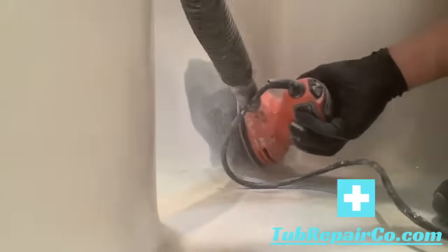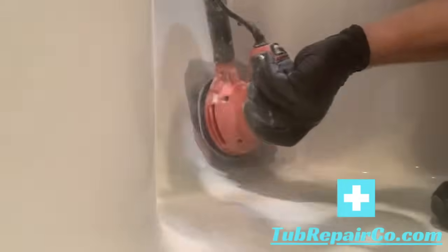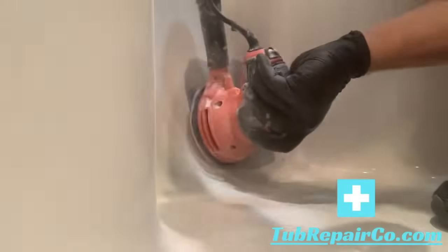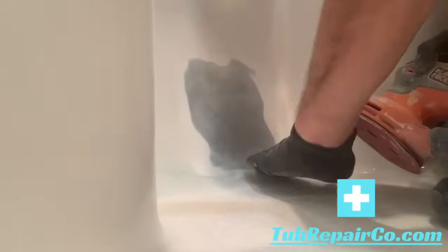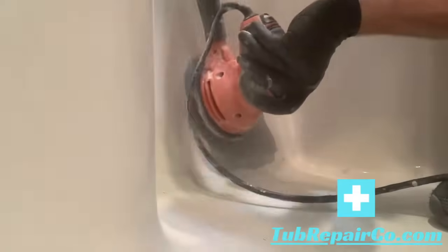As you feather this out, you're going to want to feel if it doesn't feel real firm. If it's got too much give in the middle, you may have to apply a second coat and make that patch a little bit thicker. So be aware of that, and always let it set up and cool down before you sand it. Otherwise it'll just gunk up your sandpaper and it won't stick to the surface. You've got to really let it do that.